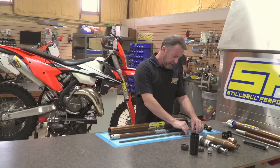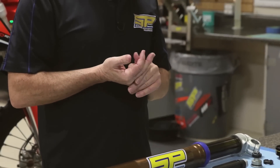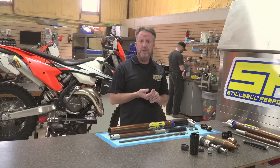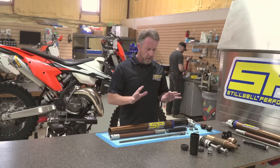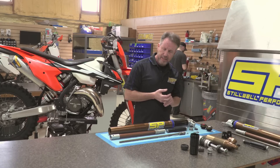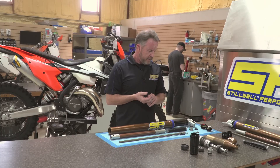We took a look at the overall oil flow and the feeling and feedback we get from our riders. Because we don't sit in front of a dyno — we go out to the trails, we go out to the track — I think it's one of the reasons we've been so successful. We really rely on making it happen the same way you are on the track or trail. What we found in this fork is that it tended to dive excessively; it is undersprung, but the problem goes further than that. The dive is really too much oil flow at the beginning of the stroke and not enough in the middle and at the end.